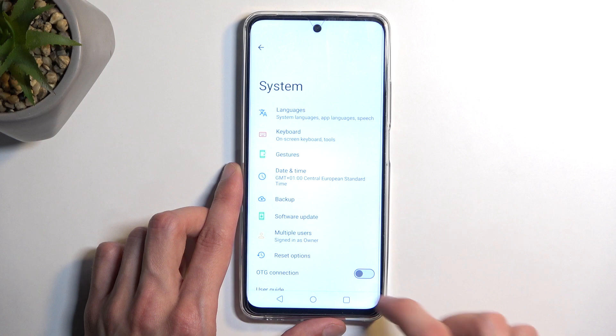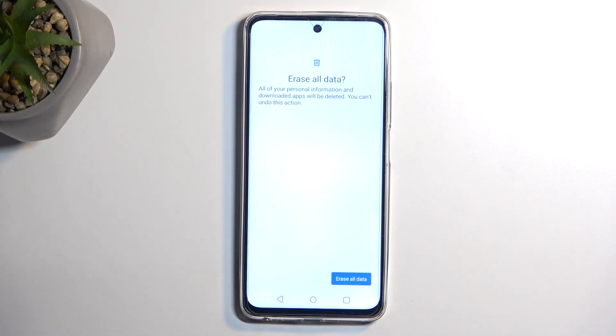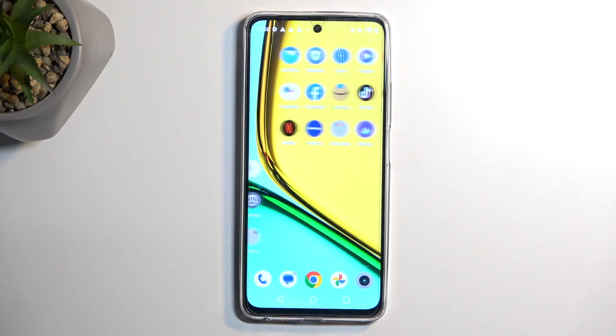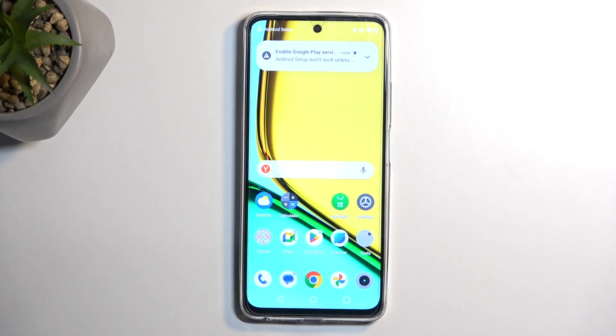In Settings, scroll down to System, scroll down again and select Reset Options, Factory Data Reset, Erase All Data, and then click on Erase All Data once more. The reason you want to do this is because the device is still technically locked — we just circumvented the verification process. When performing a factory reset through Settings when the device thinks setup is finished, it forces the device to fully unlock itself. Once you click that button it's fully automatic — the reset goes through, and once finished you're back at the setup screen where you can set up your phone however you want. So just press that one last time, it goes to a factory reset, and you're done. If you found this video helpful, don't forget to hit Like and Subscribe — thanks for watching.